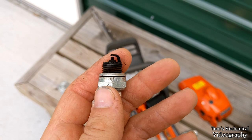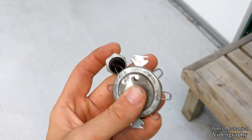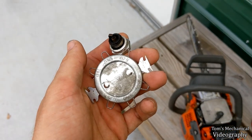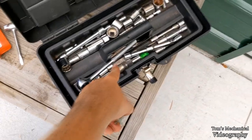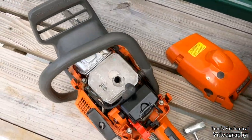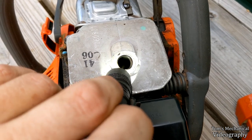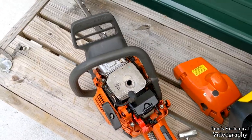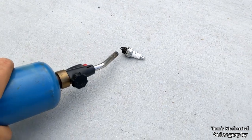I'll check the gap. That doesn't quite look like 20 thou to me — looks like it's worn out a little more. My suspicions are confirmed. I don't have a 20 thou gauge on this gap checker, but I do have a 25 and the 25 went in — pretty perfectly a 25. I'm going to tap on it a little bit and use a feeler gauge set to get around 20 thou. It's not as carbon as I thought. And looking in the cylinder, we have some non-insignificant cylinder scoring in there. I guess you get what you pay for with a remanufactured chainsaw.